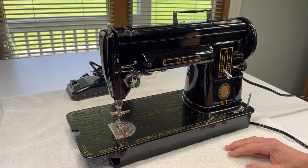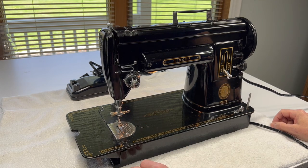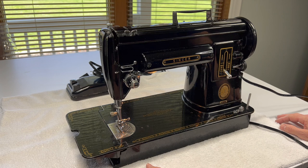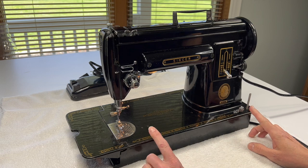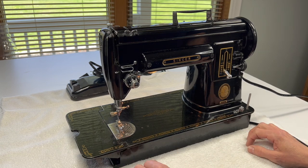What I'm going to do now is just press the foot pedal, and I should get some motion from the motor on this machine, because the person I got it from had tested it out a little bit. I'm not pressing very hard — now I'm going to go to full speed ahead. What I have is this is super slow. For a 301, they can sew over 1,100 stitches per minute. It should go really fast, and I'm pretty sure I know why this one isn't. But as we start taking apart, we'll be able to confirm whether or not that's the case.